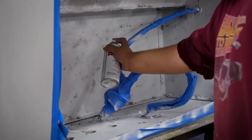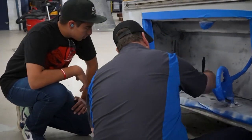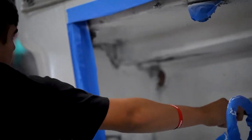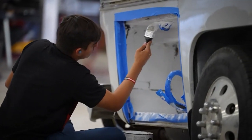As we're working on Road Force One, we're doing a couple of interior things. One was prepping the location for the propane. The reason I chose white is so it can quickly show if there is any fatigue or metal separation — this is also why you generally see roll cages on vehicles painted in a bright color, so you can see if the metal is cracking. As we put the propane in, we'll be able to spot issues really easily.